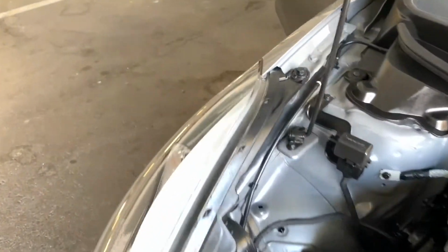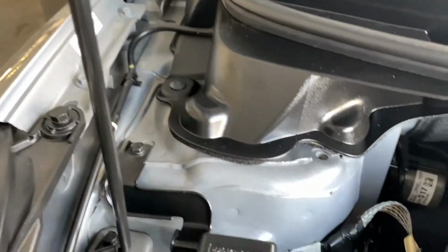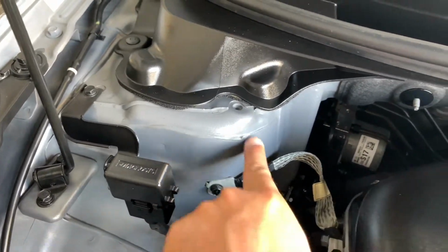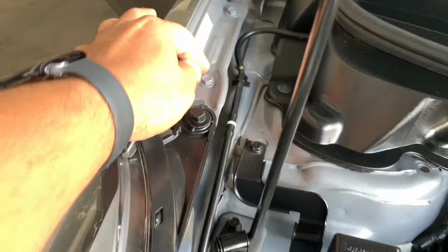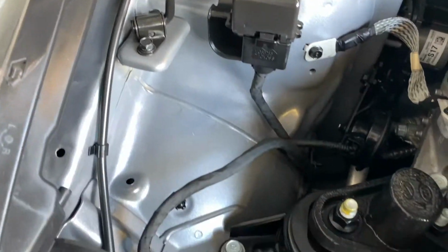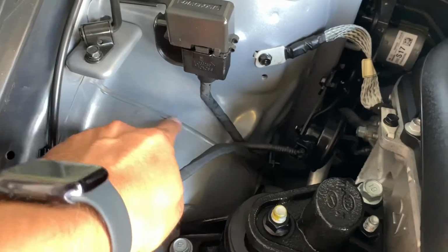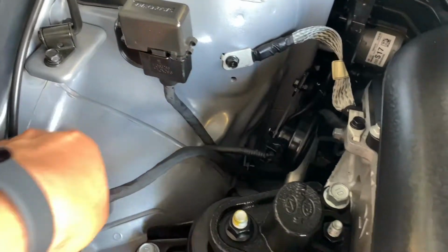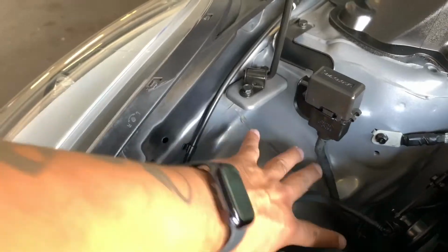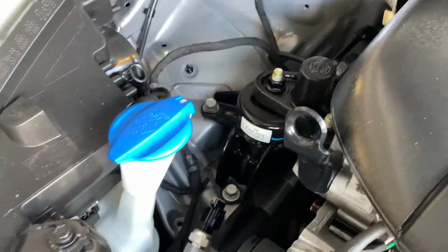Now here in the video I'm walking over to the front so I can show you guys the turn bolts, if there's any kind of turn bolts, and what your spot welds look like. There's your bolts. Make sure there's no paint chipped off of them, as well as your hood, just to see if there's any kind of previous repair. There's your seam sealer. This seam sealer is factory here, so there's nothing to worry about. And that would be your right apron.